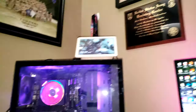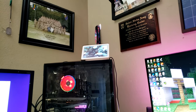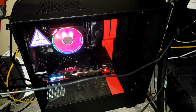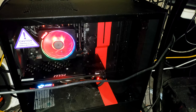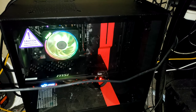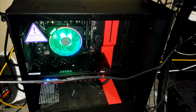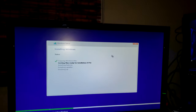It's 12:29 AM — I started around 10 o'clock. Turns out I put in the CPU wrong. The first time it felt kind of loose but I didn't go with my gut feeling. The BIOS wouldn't even load and it wouldn't POST. The DRAM light was on, but it wasn't even the RAM — the RAM tested fine. It was just the CPU. After about 40 minutes of googling and troubleshooting, it works and it's posted now.